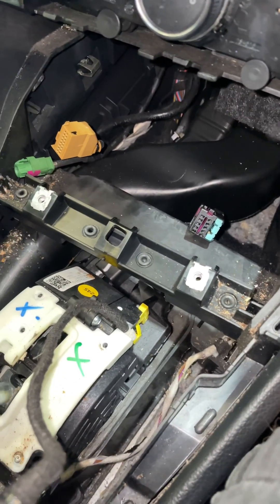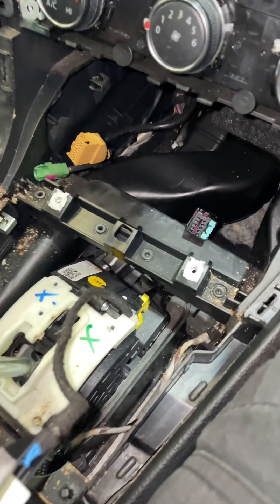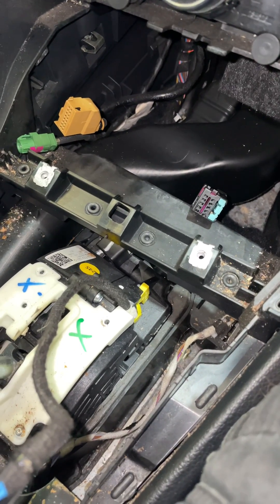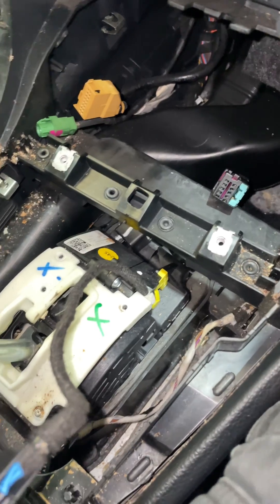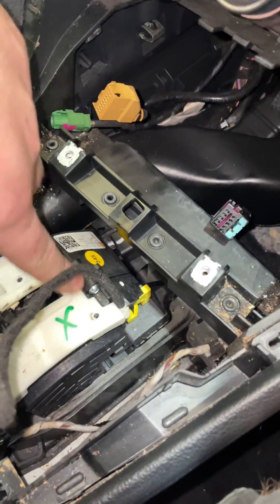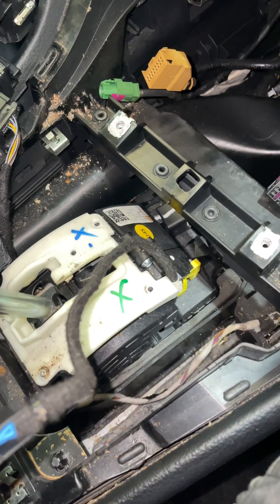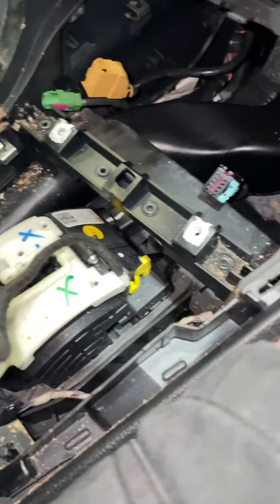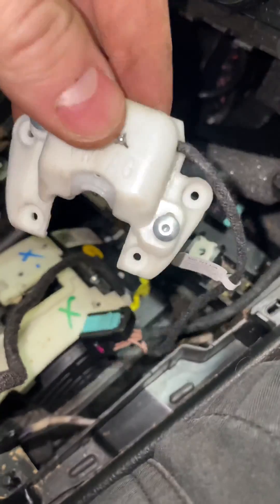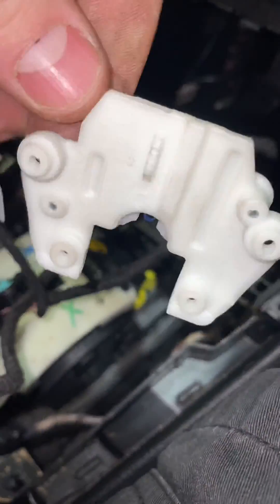I get to show you this little fault — I've not actually got one on the channel at the minute, which is rare. So, gear lever: on your screen it will say 'error leaving park'. I can't show you at the minute because I've got it all unplugged — it'll just bring up loads of faults. What it is, there's a micro switch in your DSG gear lever that has failed. There is a part that just goes on top, and let me show you the part number.